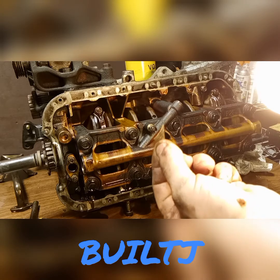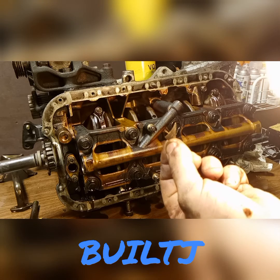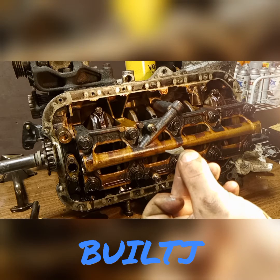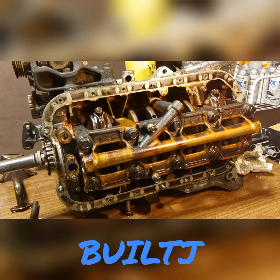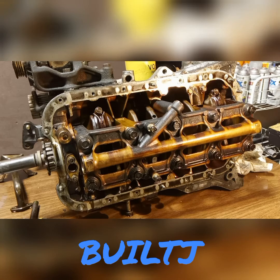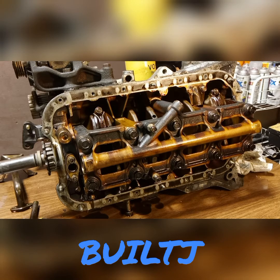That's the first course of action — drop the oil pan, take a look in there, see if you see any pieces of metal, any shavings. It's going to look like glitter. If you do see fine speckles of glitter, or metal shavings, then you probably most likely have a spun bearing. You want to go ahead and correct the problem as soon as possible before you start hearing a very heavy knock.